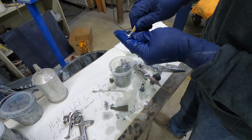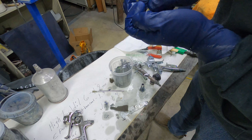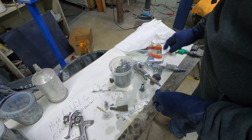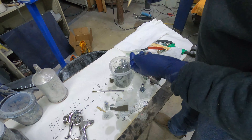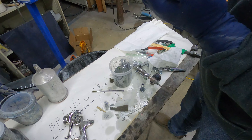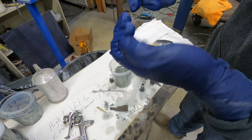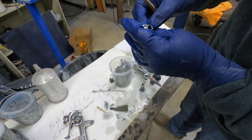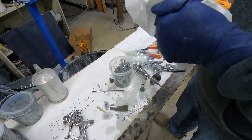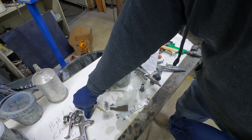I can also take this and just jam it in here and twist — jam and twist, you'll form the wood to the orifice. If the piece is starting out too big, use a more tapered one. Just don't push too hard or you'll break it off in there. You can see it twisting around and then it pops out. Now we know that seat is completely clean inside — nice and polished up. We'll call that piece pretty well ready to roll.